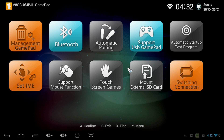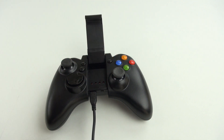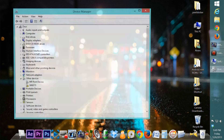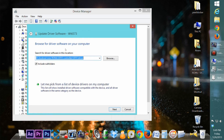You might need to update the firmware on your controller to make it work correctly with this software. To install this firmware, it's a little bit tricky. First, hold Start and Select at the same time on the controller while you plug in the USB cable. This update is kind of like an Android mini PC — first you'll install the USB drivers, and then you'll update the firmware on the controller. Once you plug it in, you'll hear a ding, go to Device Manager, and you should see an unknown device there.